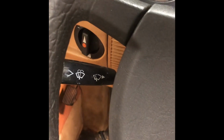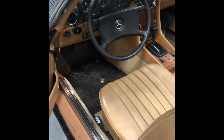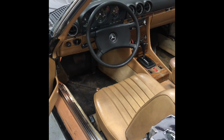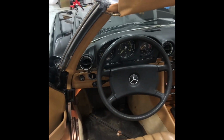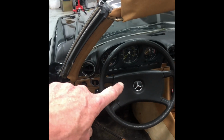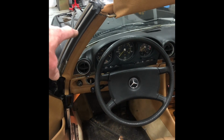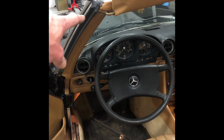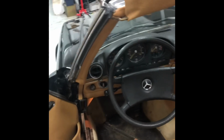Yeah, this is all right. Oh, fuses are still looking good. I am pleased. I just checked. I have brake lights. I have reverse lights. I do need a flasher relay. Gonna have to take off the steering wheel after I disconnect the battery, pull the instrument cluster because the relay sits behind the cluster on an 82. That's for another day.